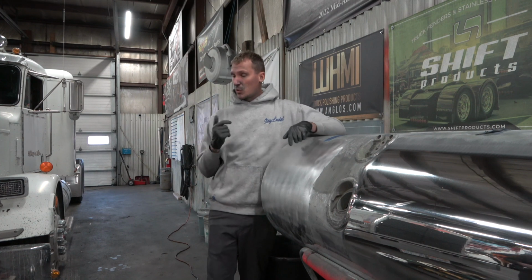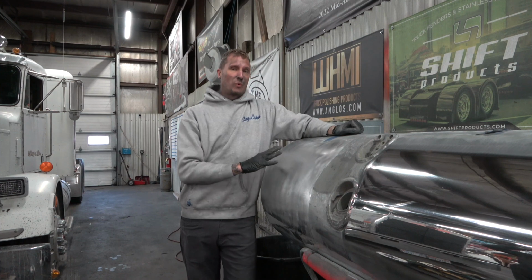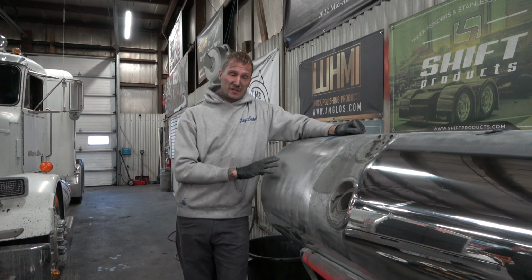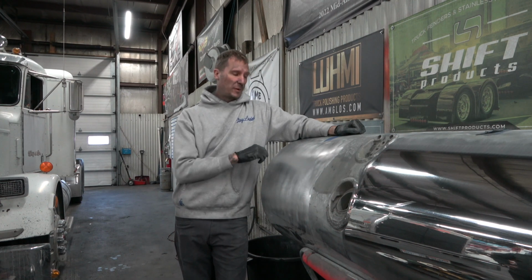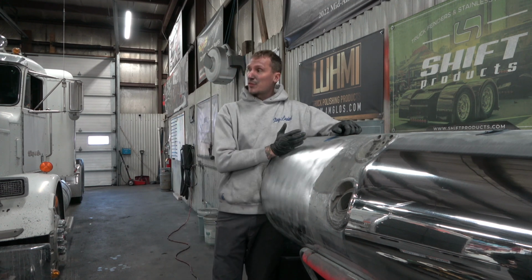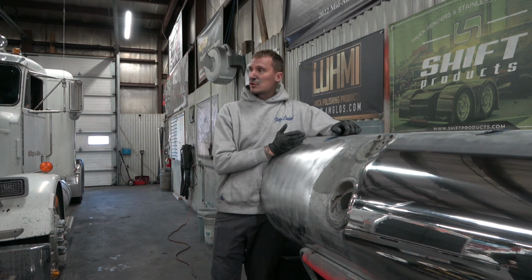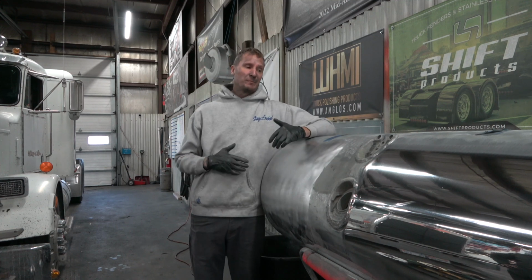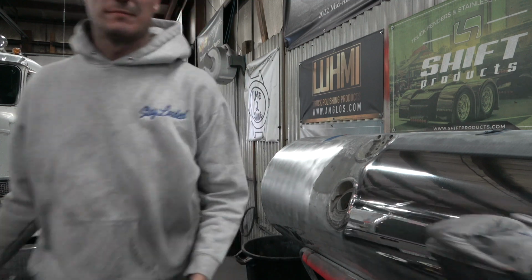First step is orange and regular brown. And all we're doing on this first step is trying to get some moisture into it. So as you watch, he's not going to be shooting for perfection on this step. All he's doing is laying compound down. So every 2 to 3 inches we're going to be laying compound on. The second pass we're going to use less compound, and then if we see some pigtails, we'll go a third pass. The third pass should be absolutely perfect before we go to our yellow, because the yellow is just honestly lightening up our hash marks at that point. So we'll let Nick take over and we're good.